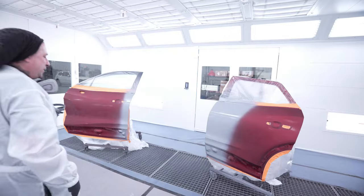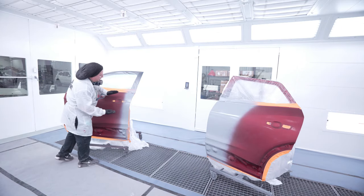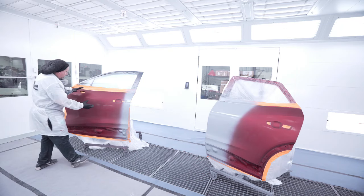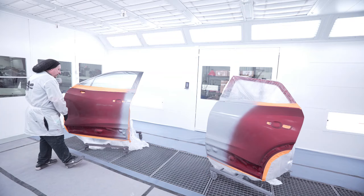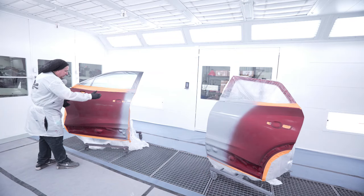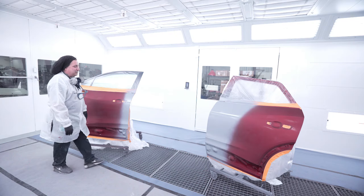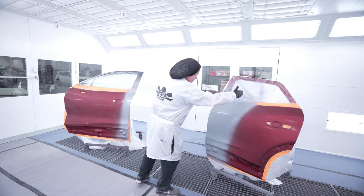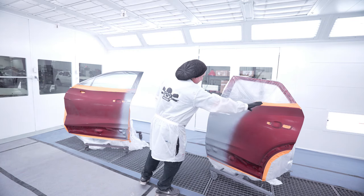All right, so you see we've got our sealer applied, and when I was doing this, I was blowing everything towards the area that I'm gonna be painting up to the other door. You wanna make sure that you leave as much of this as the original blend area, because you're gonna start to bring your sealer, your color, your mid coat, and you can have a chance of getting to the edge of your panel, and then you're gonna have a problem. So even here, we're gonna be fixing up towards this, so it's crucial to try to stay off the back end of that panel.